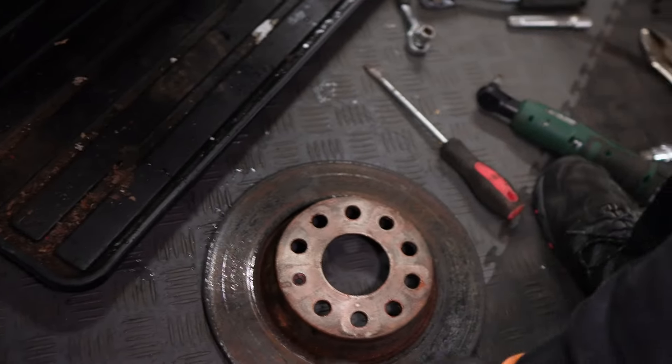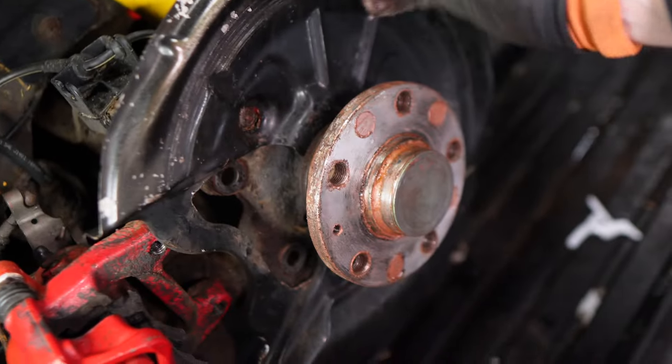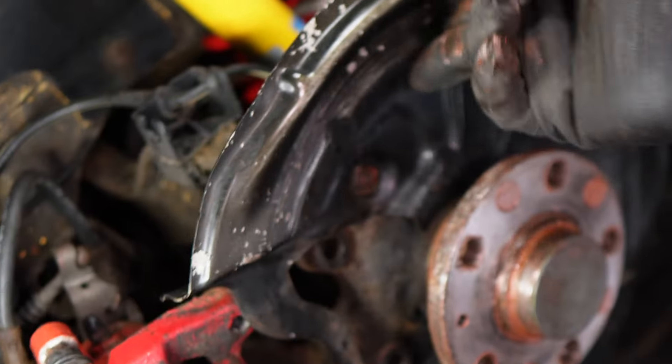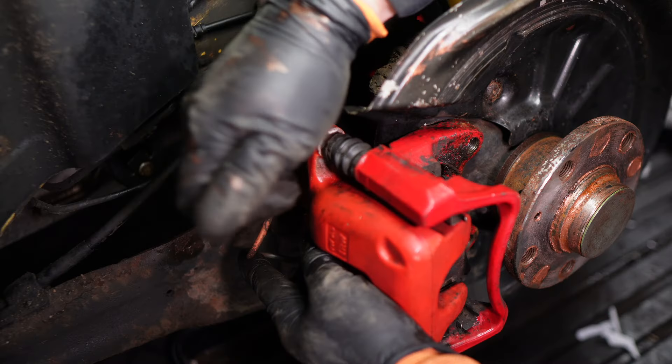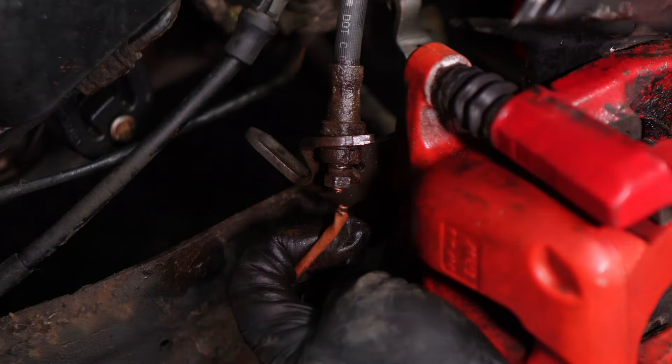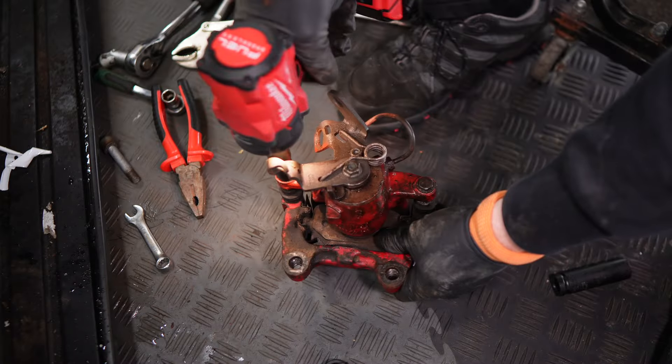You can see the state of the brake disc - it's pretty well worn, a lot of corrosion. There's a groove rubbing all the way into it. The backing plates - I wasn't going to replace these because they're actually still solid, but you can see there's a hole there, it's rusted through. Once that falls off it sits against your brake disc and causes that horrible noise when the backing plate rubs as you're driving. So I'll replace the backing plate with three new bolts. Then I needed to get the caliper off the braking system - off the handbrake and the brake pipes - and separate the carrier to spray it. Getting this pipe off is always a pain; it was going round and round with the nut and gradually turning the pipe as well, until it actually snapped off altogether. I have got replacements on the way.